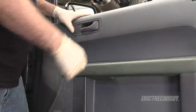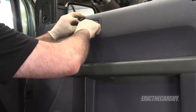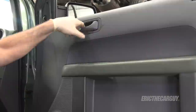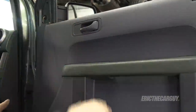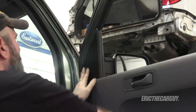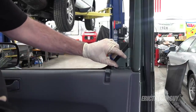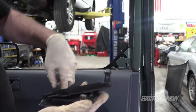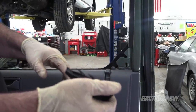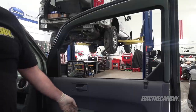For the door handle, hook it in and move the clip over onto the rod so it stays secure and doesn't pop back out. Hook the bottom first, then hook the top. The bottom of the cover goes in first and then the top clips in. I can hear it actuating — I always like to verify it. The upper cover just sits in here. These two indentations are what the cover slides down into, then you fasten it down. To remove it, pull the bottom straight out and slide it up. One last check to verify operation.